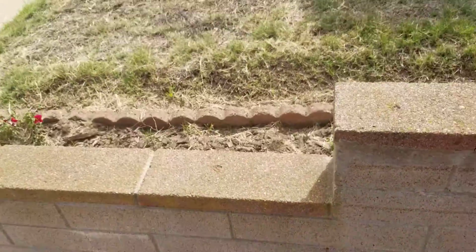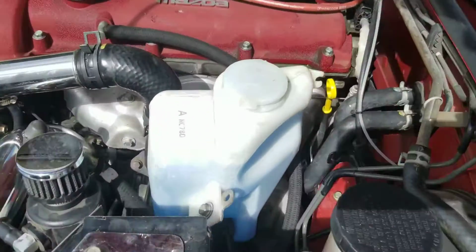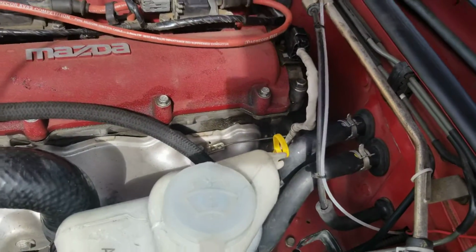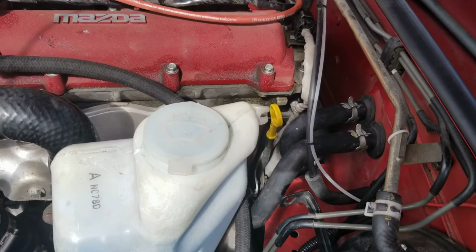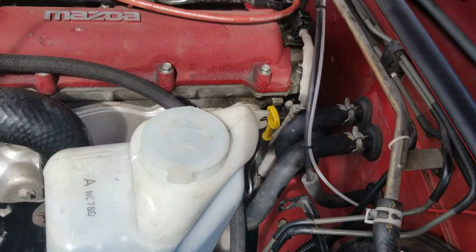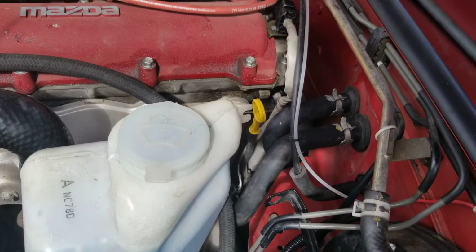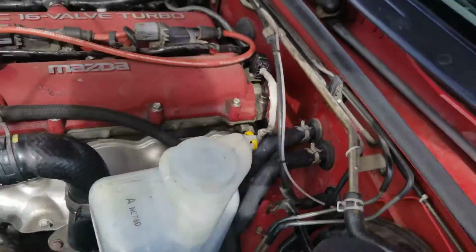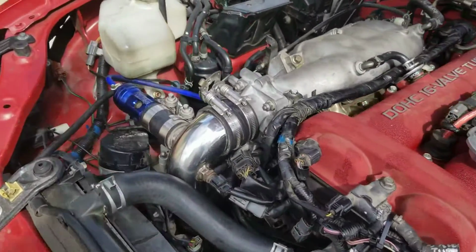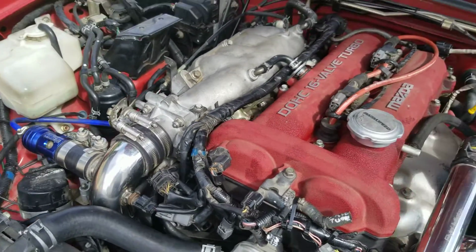As far as the exhaust goes, underneath, just as a reminder, you've got the bolts that are on the front of the manifold there. Let's see, it's a 14mm at the head up there. Make sure you use anti-seize on that. Ryle also told me in the fuel line to add a little silicone grease, dielectric grease, that helps it slide on a little bit better.